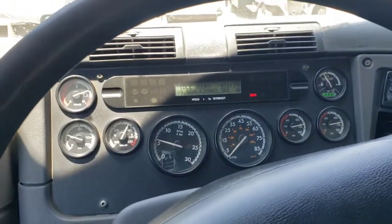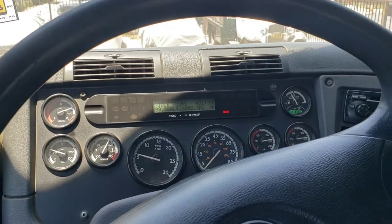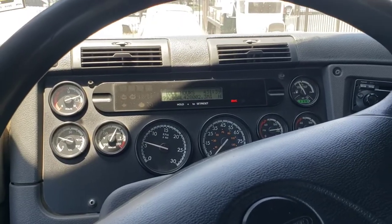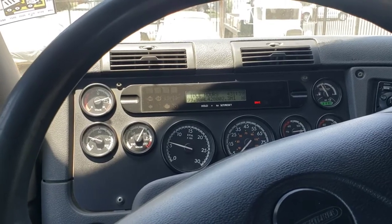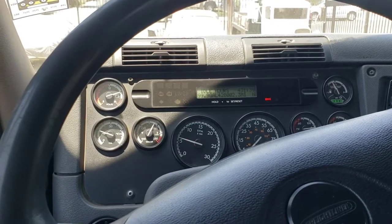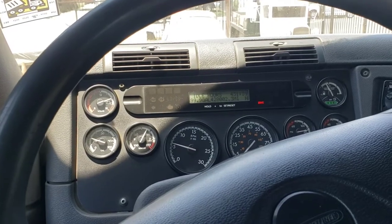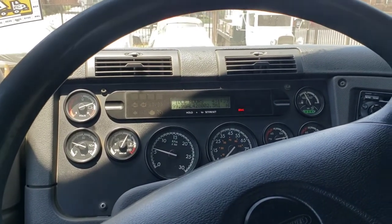So to wrap up this video, I wound up getting everything back on and back together. And I just drove the truck. It drives 1,000% better, man. In my opinion, I think it was the VGT. So if your truck is lacking power, you got to have it to the floor to take off and stuff like that, change your VGT for sure. Then I would go to the Delta P sensor, then the IMAP sensor. But yeah, for sure, that VGT definitely was it, in my opinion.